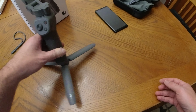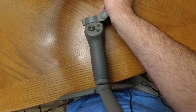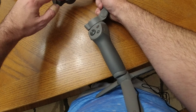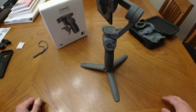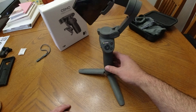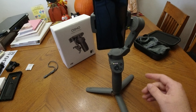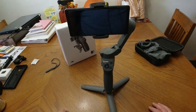I'll show you the best way to set this up. They say you should hold the gimbal like this when putting your phone in. The sticker tells you to make sure your phone camera is facing to the left of the DJI logo. You're also going to want to center your phone as much as possible to get proper settings with the motors. To turn it on, press once and then press and hold — then it powers up. It automatically powers up into portrait mode, but you can change that by pressing the mode button twice to switch to landscape mode.